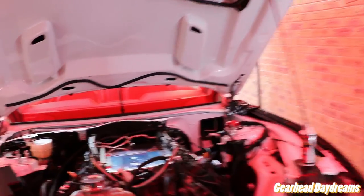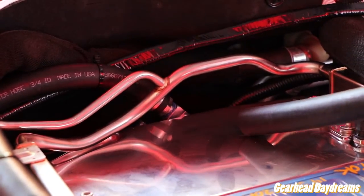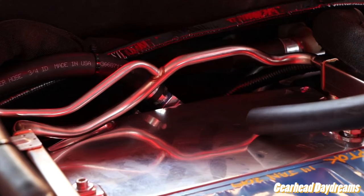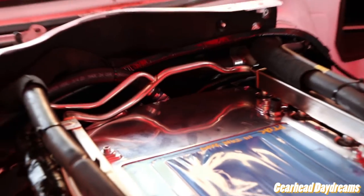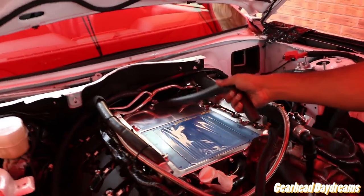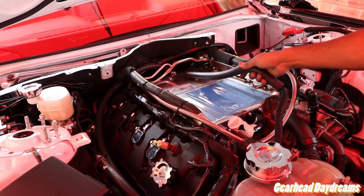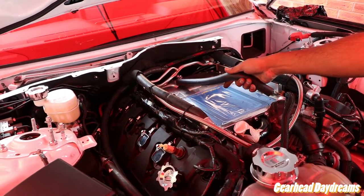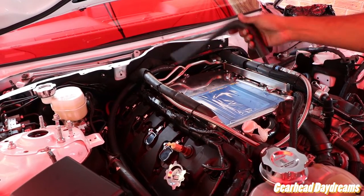You want to just say what we had to do with this? Yeah, so it came like this from the factory. I'm talking with reference to the US guys now, so European is different, just bear in mind our steering wheel is on the different side. Based on the American steering wheel, which is on the left side of the car, our long hose, the 57 inch, which goes directly to the heat exchanger, is on the driver's side. And our 30 inch, half inch inner diameter hose is on the passenger side,